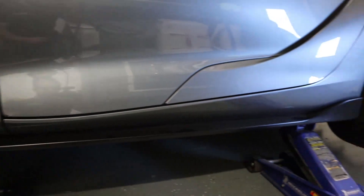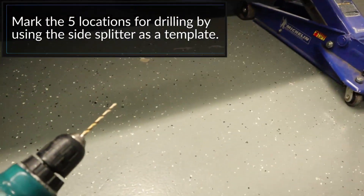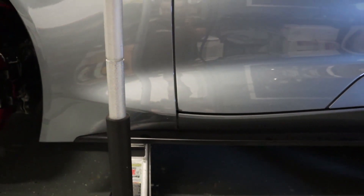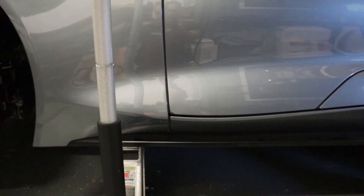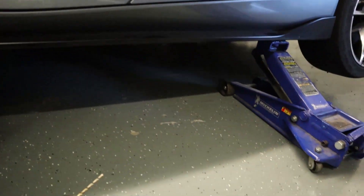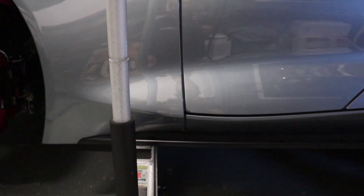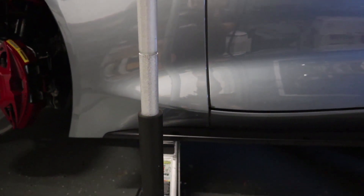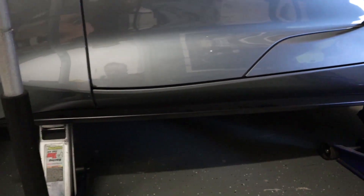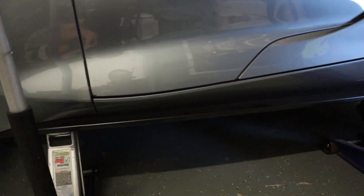At this point we have marked the five spots on the underside of the splitter. We're going to take our 11/64 drill bit and make pilot holes. If you are using the plastic screws, stick with the 11/64, insert the screw into those parts with a fender washer, install the side splitter, and you're done. For the rivet nut method, we start the hole then enlarge them to 3/8 inch — except for the front hole, which goes into actual sheet metal so we use a sheet metal screw there. All the back spots get a 3/8 inch hole so we can install a rivet nut.